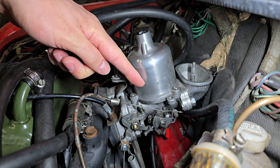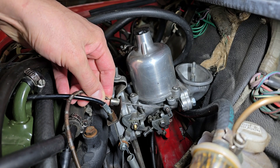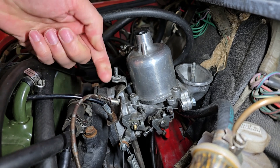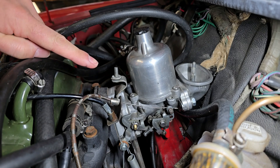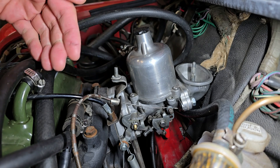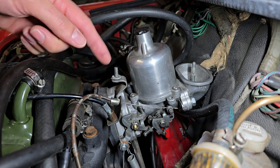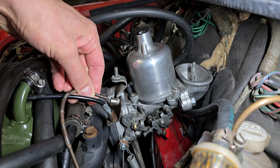As you just saw, I pulled the choke out to a high idle speed point and then continued to pull it out further to full choke. At this point the engine started easily, the RPM started rising up, reached a peak, and then we hear the RPMs falling back down. The RPMs continue to fall until we hear a chugging sound — that chug chug chug sound is what over-choked sounds like. Too much fuel is being provided by the choke system itself.